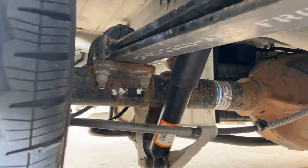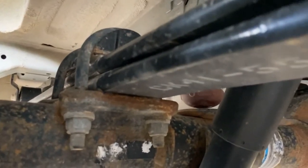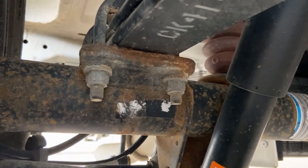We have our U-bolts. Oh, okay. Wait, oh, rats. Knock that out of whack. We have our U-bolts. Right there, it's that thing that's making a U over top of it, coming down. We want to make sure it's securely mounted on both sides, not cracked, damaged, broken, not missing any hardware.